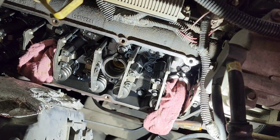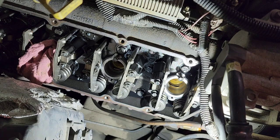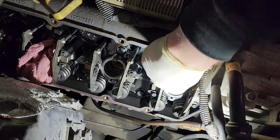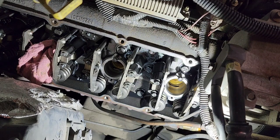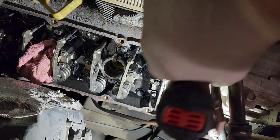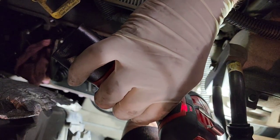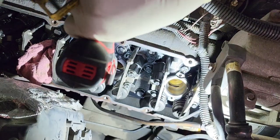All right, I've got the rags in there to keep any oil from running down into the cylinders. Step one is we need to remove this 8mm bolt here, because the tool uses those bolt holes to remove the sleeves. Just make sure that you put these bolts back in before you put your injectors in, because they don't need to be out for injector service.